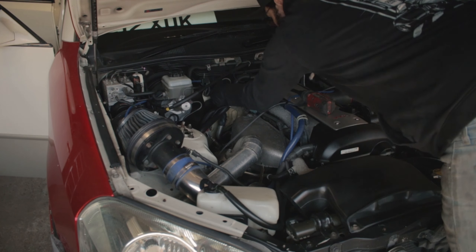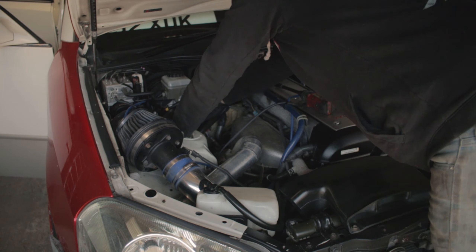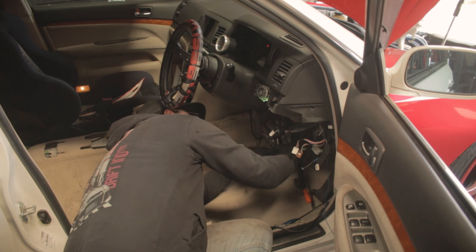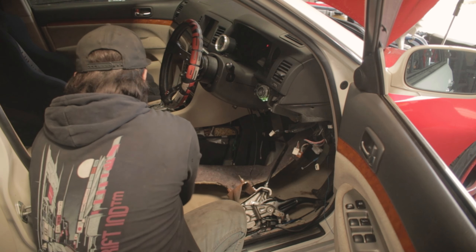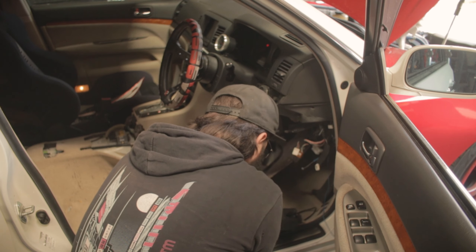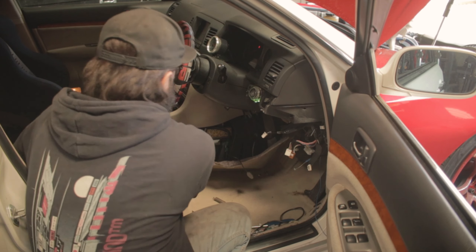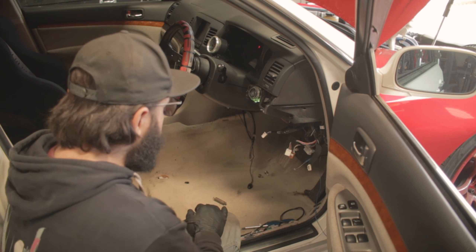So, two 12-mil bolts. There's also a random bit of wire using this as an earth. I'm sure there's another bolt from underneath the dashboard. The pedal just comes out and we put a new one in — nice and easy. There's one bolt there and one on the other side, so two 12-mil bolts total. There's also a switch on there so we've got to be careful with that. The cable is ducted here and goes underneath, so the best thing is to disconnect the cable. We can fully disconnect it when we're under the car, and that gives us all the room to install the pedal.